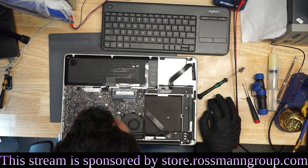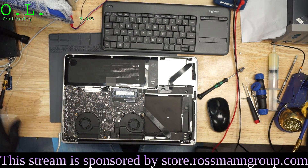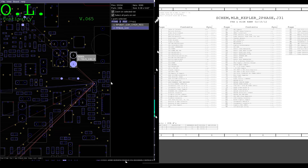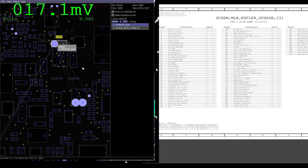The first thing I'd like to do is check my PP bus. What voltage is my PP bus? Is my PP bus G3 hot or G3 not? I can measure my PP bus here on R6905 for the input of the PP 3V42 circuit. We have 1.2 volts on the PP bus — that's no good. The DC in is 18 volts, but the PP bus is only 1.2. Let's see if we have a short to ground on the PP bus. 6.23 million ohms — there's no short to ground, but our PP bus is not there.